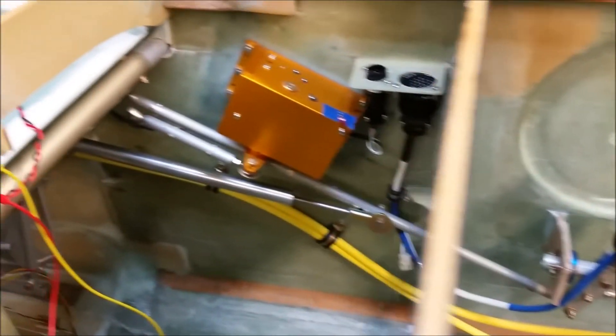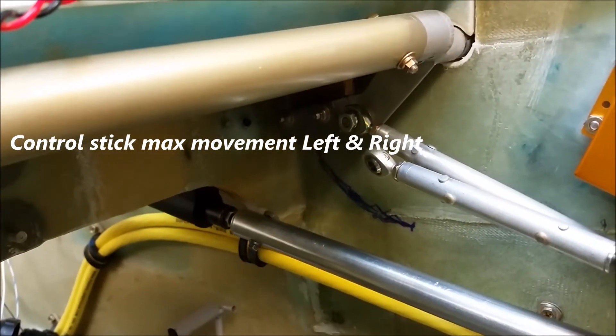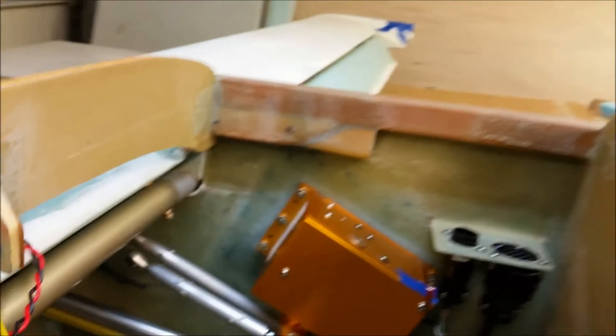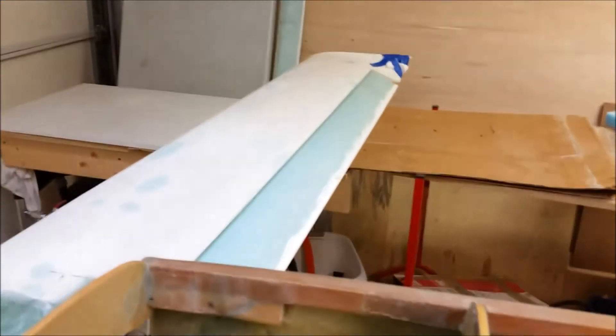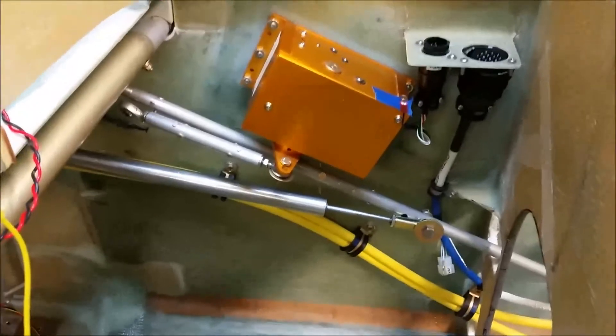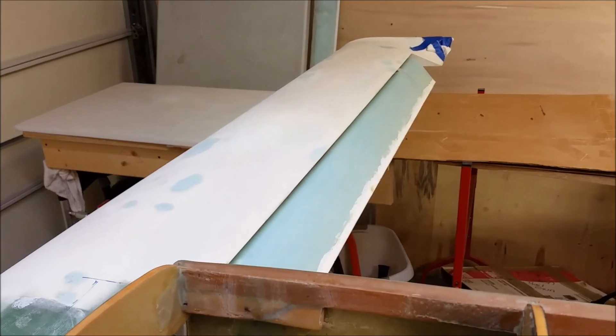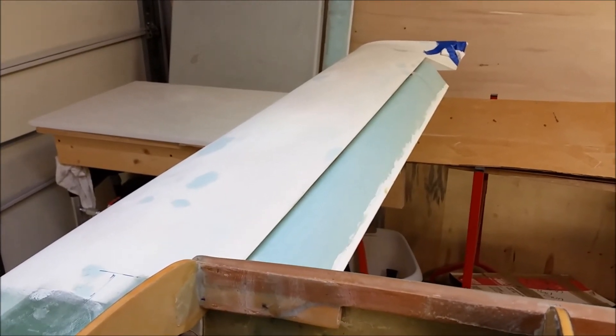Thanks for watching. This is the Vance Atkinson pitch trim. I can show you quickly — this is all the way to the left and this is all the way to the right, maxed out in those positions. Even though it's all the way down, I can still move the stick forward — it only brings it up to zero, but that's all it's got. I would have to retrim it, but the spring force isn't too bad. Full down, controlled by the Vance Atkinson pitch trim. That's it — thanks for watching, cheers.